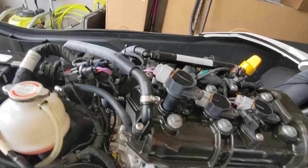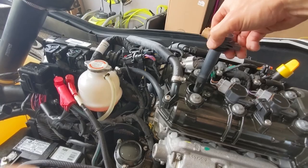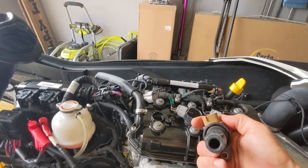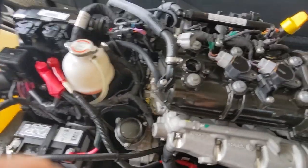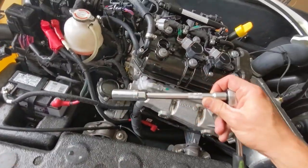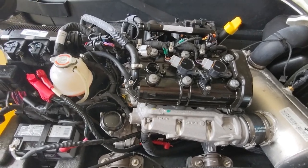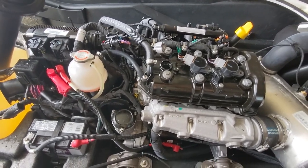They pull right up out of there. You have to unclip this — got it undone. Pull this straight out of there — that's obviously what goes into your plug. Then see your plug in there, grab yourself your spark plug socket, get down in there and unscrew it. That's that — put the new one in, put everything back together.